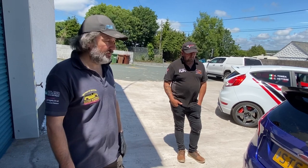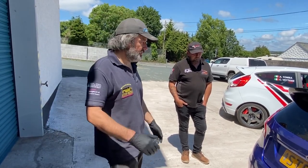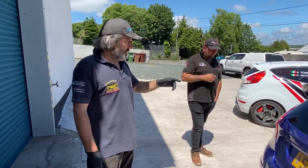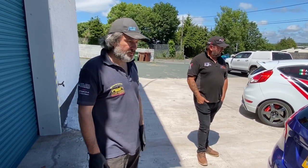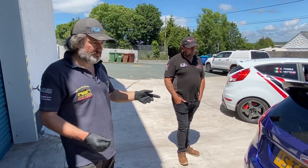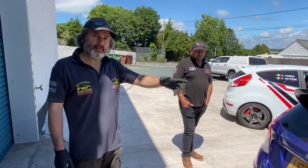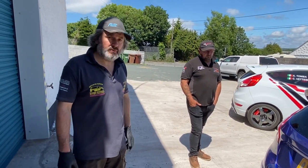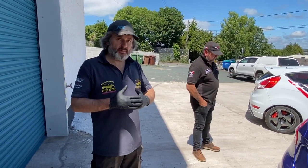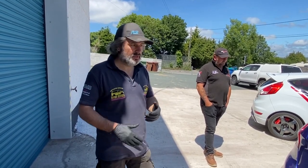He might do a little bit, but he won't do much because the timing won't see it. All right, so you need to advance it off, but he won't see it. So looking at it in that respect, yours and Malcolm's, it's got that advantage over, and he knows that because you're not running pretty race fuel in it, but the methanol will crank it up beyond 102 octane. Yeah. Again, it's only looking for 102, so it won't do much. If it's 104, 105, it won't do much more because it's only looking for 102.